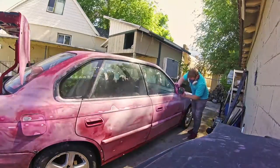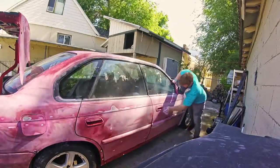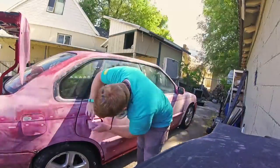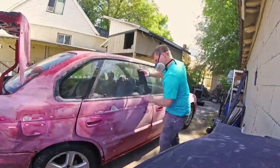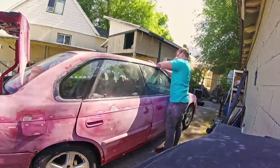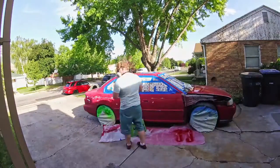Since I'll be spray painting the car I already expect a few imperfections, so sanding higher than 320 grit won't have much effect on the end result — it would be a waste of time and money. Be sure you're using a dust mask while you prep. I've gotten sinus infections and bad head colds from not using proper protection even on small paint jobs. At minimum use a dust mask, but I'd recommend a respirator like mine — I picked it up for $12 and have had it for about six years, totally worth it. When your prepping is all done, wash the car and check for any spots that are still glossy; if it's completely flat, you're ready to mask everything off.